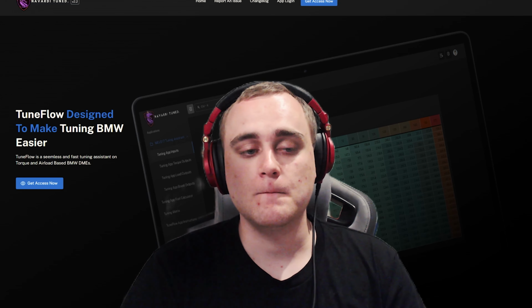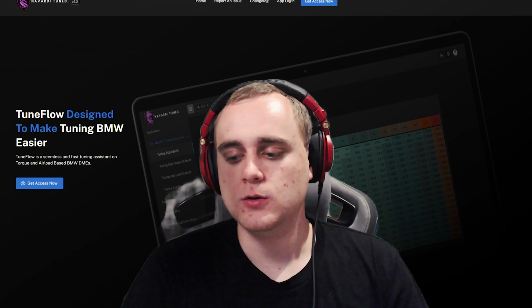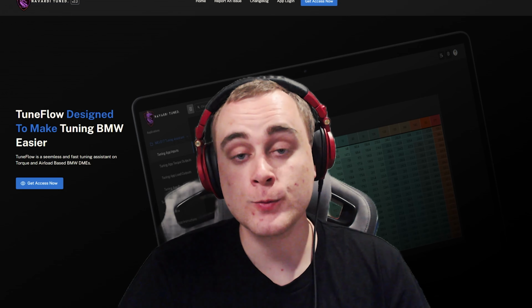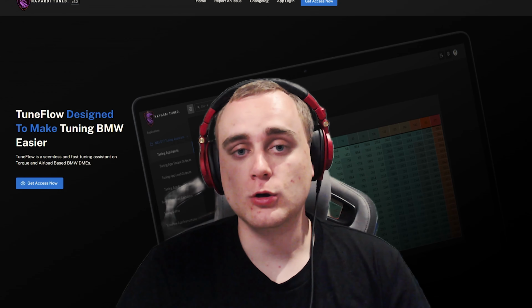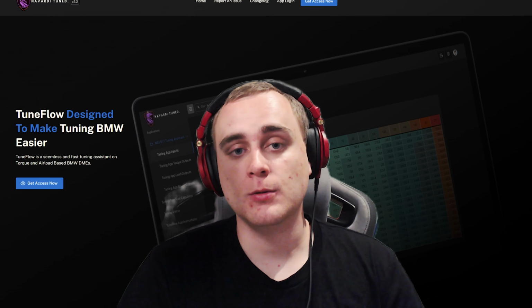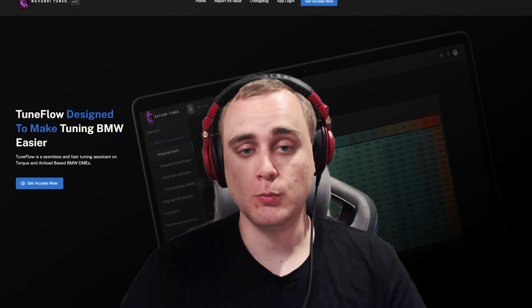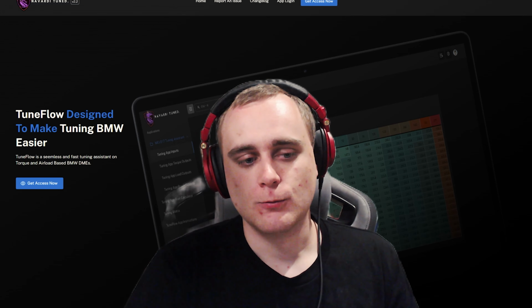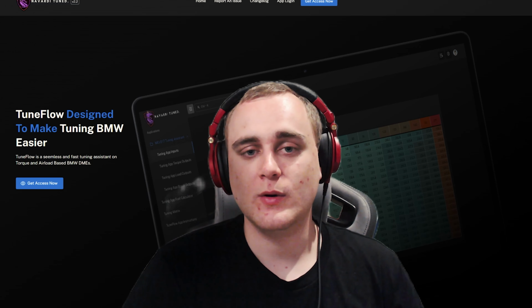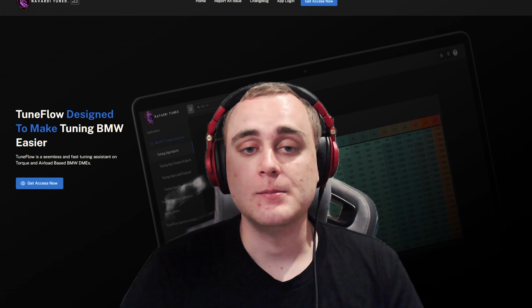Say you want to build the motor to make 450 horsepower, you build it for 600, right? You want to make 600, you build it for 700. You build in that room for error, so that if things do go wrong, you have hopefully the strength of the internal components to withstand any out of the ordinary abuse that might occur. The problem we had is the sleeves we had installed really were not designed for anything more than what we were actually asking from them. So when push came to shove, they ended up cracking. They weren't thick enough for our application.